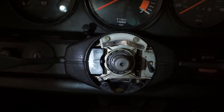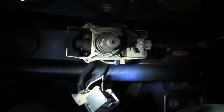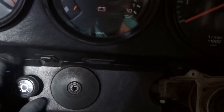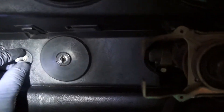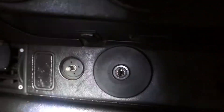We've got our steering wheel off and there are a few bolts to remove. This is the horn contact right here. Take those two off, then there's one, two down here, another two up in there, and then two more here on the side — one there and one on the other side. Now we have our switch out hanging right here and you can see it feeds through to the back and to this light switch. We're going to unscrew that and figure out how to pop that thing out.